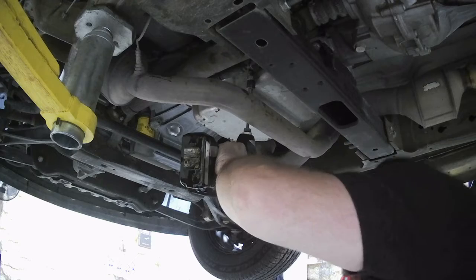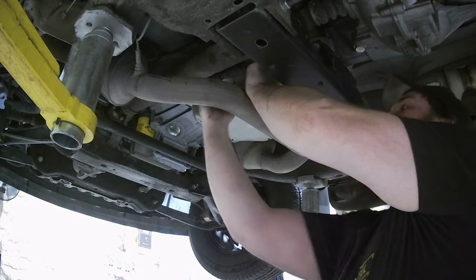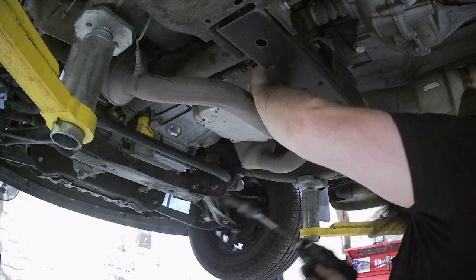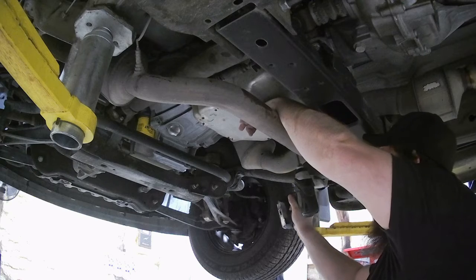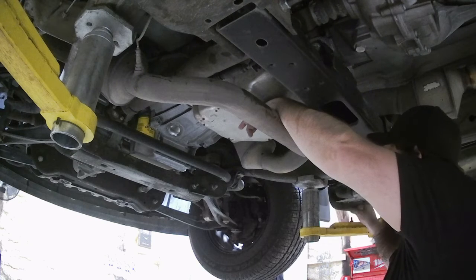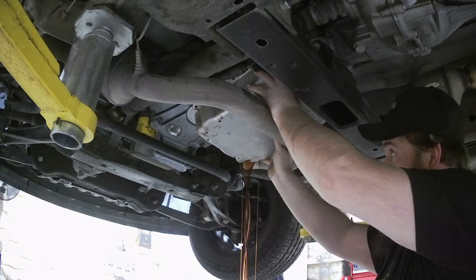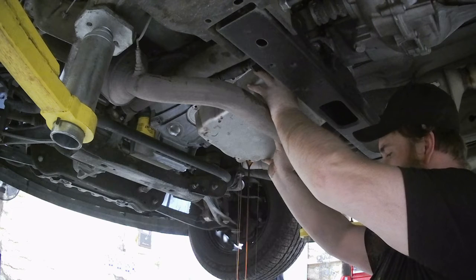She's coming — pretty close, if not out. There we go. Wasted all that time and what for? Pretty much nothing. Now hold the pan up, get that other bolt out that we put back in, and then slowly let it down to drain. It's best to just hold it and let it do its thing until it stops, and then you can pull and tilt some more.